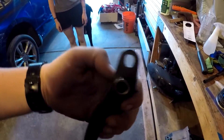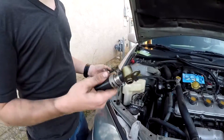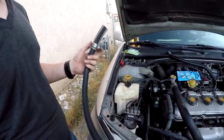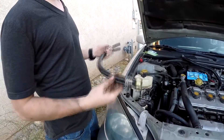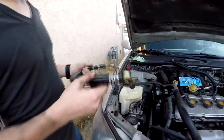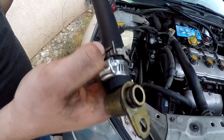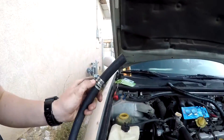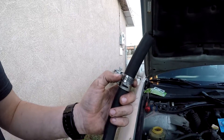So we've got this all connected up - this just pops in. I'm gonna put a clamp on the end of this, and the bolt goes through there and tightens it in. The other side goes up to the reservoir, which I'm gonna clamp down. I'm going a little overboard and doing two clamps just because I want to make sure it has a good seal and it's not going to crack. I took the clamps off of the old line and ran that one here too. This is just a return line so it shouldn't strictly need it, but it's always better to double up.